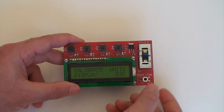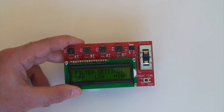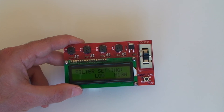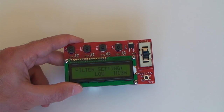And finally, the last thing you can change in this version is the filtering. Let's hold down filter. You have three options: you can turn the filtering off, and you'll have fast response, but sometimes the numbers can jump all over the place and it'll be hard to tune your engine.